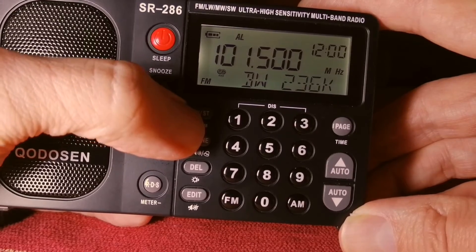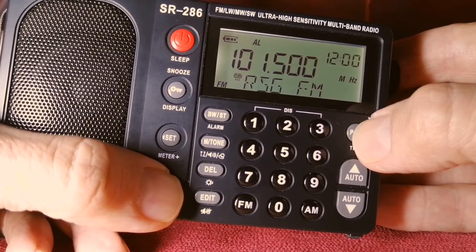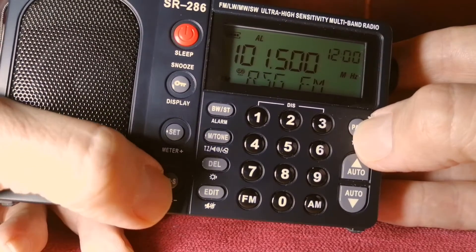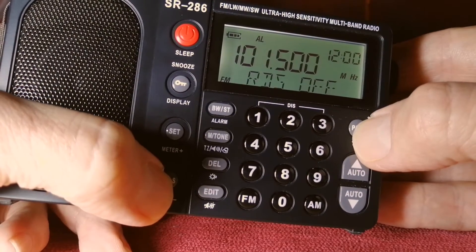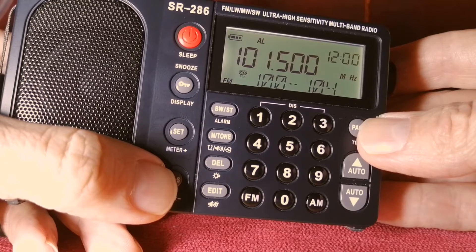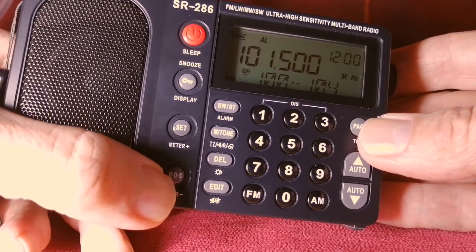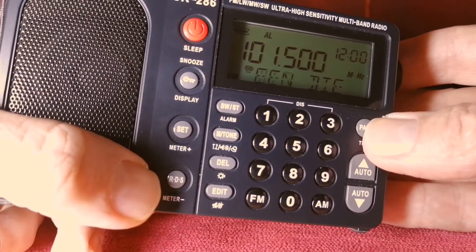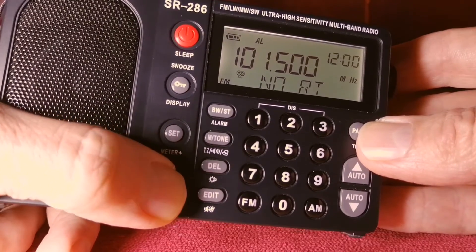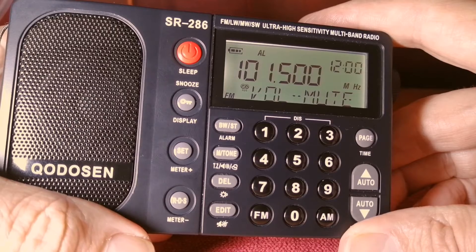Your bandwidth settings are quite easy because there is a dedicated Bandwidth button. In shortwave you simply press it to toggle between bandwidths — shortwave has three, four, six, and eight kHz options. In FM you have a ton of bandwidths, I think 17 or 18, and you just toggle between them by pressing the Bandwidth button. While in FM, to activate or deactivate RDS you press and hold Page and RDS together. Press Page and RDS to turn it off, and again to turn it on. During the initial settings is where you would have selected whether you have RDS or RBDS for the US. With RDS on, you toggle through the various RDS displays by pressing the RDS button.